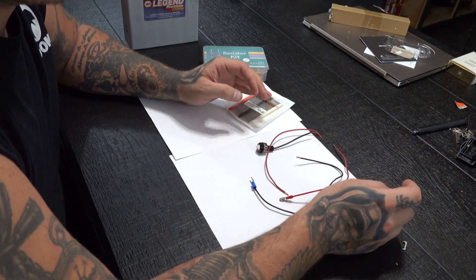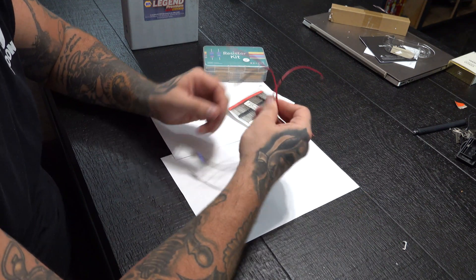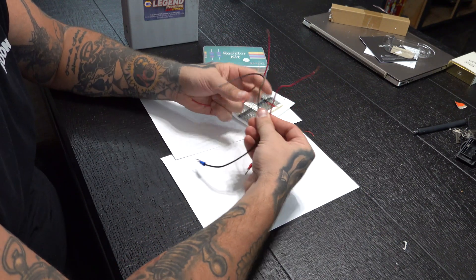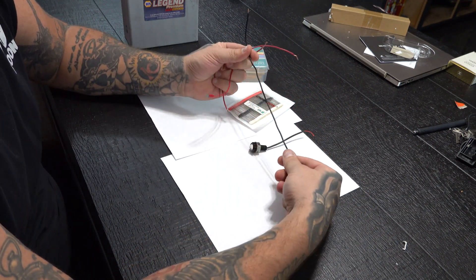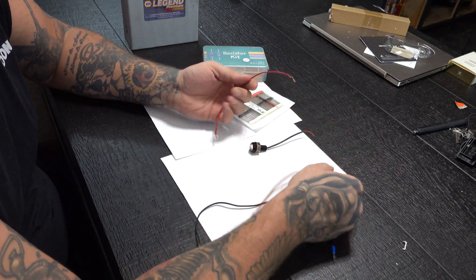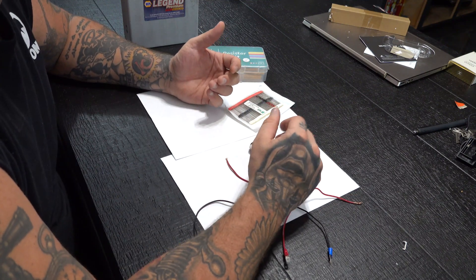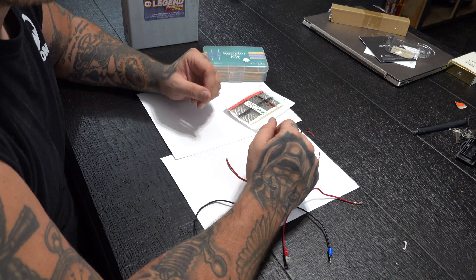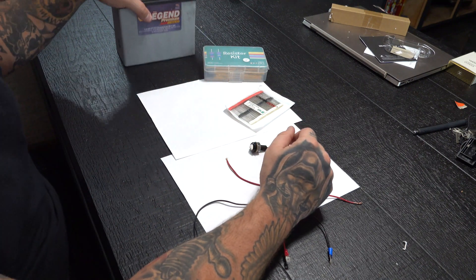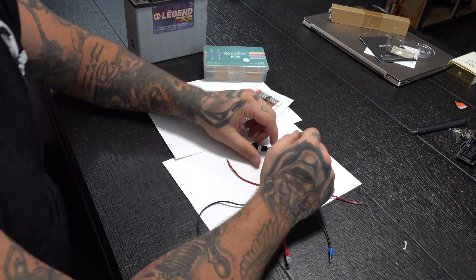Things that go unsaid anyway — these pieces of wire: black is going to be ground, and then the two reds — one is going to be constant power and one is going to be intermittent power, which you would be getting from a brake light switch or a turn signal relay or something like that. Obviously I also have a battery here so that we can provide power to this light.